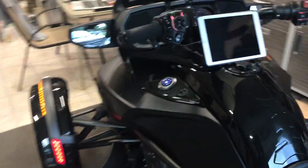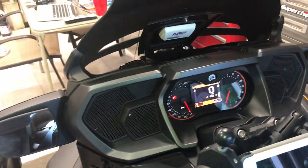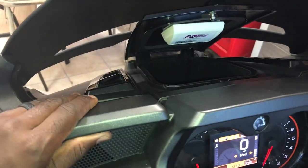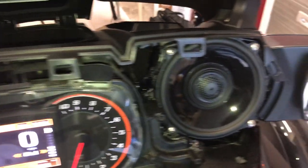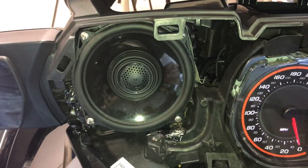Back to the Rockford Fosgate system for the speakers — I installed off of the Harley-Davidson line they have the TM-S6-SG 6.5 inch speakers. As you can see, they're installed there, and I can still use the factory dash. I basically modified the speaker pod housings that came with the Spyder OEM and modified them to fit the 6.5s. The grill fits just perfectly fine on there.